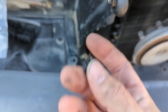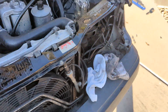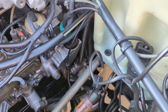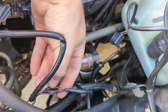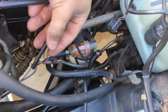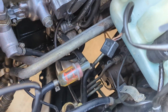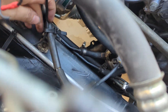I'll do that to both sides. Then I have some interesting wiring issues to sort through — I found this mystery wire coming from the wire that goes to the AC compressor. There's just this mess here, all electrical taped up. The AC compressor's only got three lines but there's a fourth one — actually five lines total, and one of them is going to something over here in the AC. I'm not exactly sure what — maybe it's going to ground.